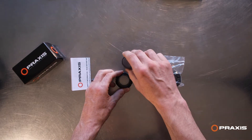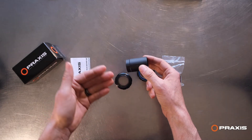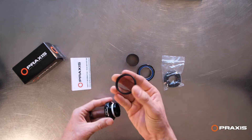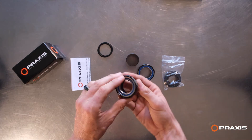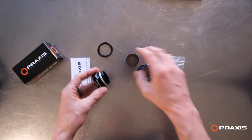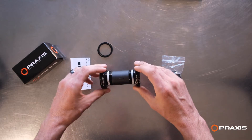This is your moisture tube that basically protects the spindle from any of the hydraulic lines or any of the wires that you might have from a DI2 type system. And then here are some extra cup spacers — we'll talk about that in a moment. And then the left cup. You'll see the L and you'll see the torque settings. This is the 28 millimeter side. You'll see the C clip holding the bearing in. So there is the right and left — the full M30 BSA.